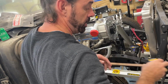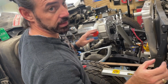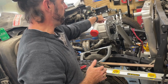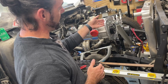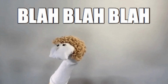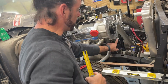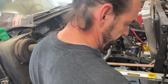Holy crap, did I luck out by some miracle. These little spacers back here just happen to be the exact correct depth for making the block of the small block Chevy flush. And then I had a 1/2 inch plate back here and then a 2-inch spacer. And then this plate, which I just happened to machine kind of arbitrarily at some depth to recess the supercharger in, I used 2 pre-made spacers and voila. 2 inches on this idler, so this idler's perfect, which is astounding. I have like some random spacer under that.